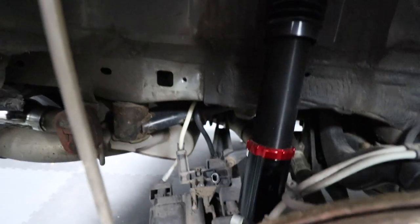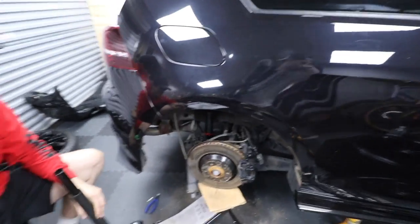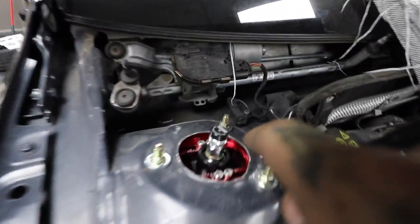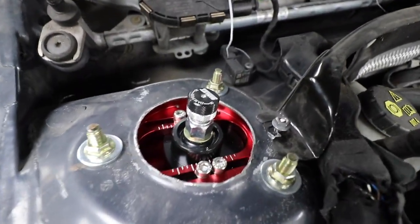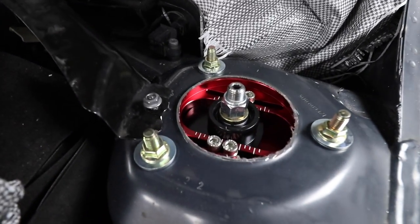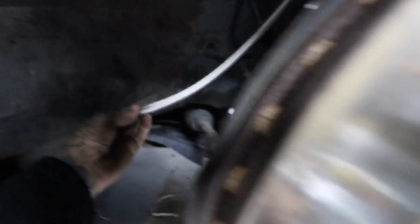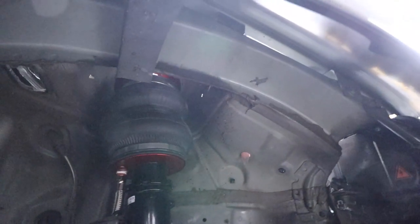The rear dampers are in - as you can see, that's the damper. I was actually under the impression that you didn't have normal dampers with air ride. I've got to paint the ends and clean it up a bit but we cut this out a little bit so that we could get to the camber settings on both sides. Thanks to Ryan for helping out with that - pretty much would have been very very sketchy. The airlines are in, the DCCD delete kit is in. I've got braided hoses, the bags are in there looking absolutely serious.